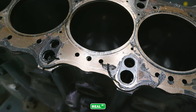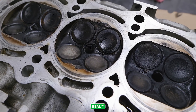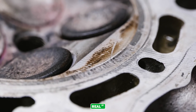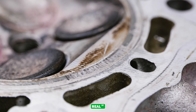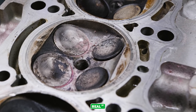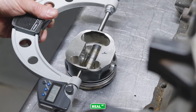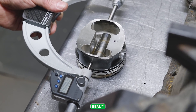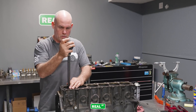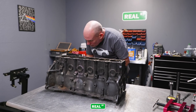You really need to be aware of how ignition timing, octane, and the mechanical compression ratio all intertwine. There's exhaust back pressure and a lot of things at play that trap heat into the engine and drop heat into the cylinder, and then the cylinder can run away and detonate. When it detonates you're pounding piston pin bores, pounding rod bearings, displacing the oil that keeps the piston cool. If the head gasket system is strong enough to sustain the elevated cylinder pressure, you just move that failure point further down — components have gotten tougher and tougher, like early 4G63 engines that would just blow a head gasket right away as their fuse.